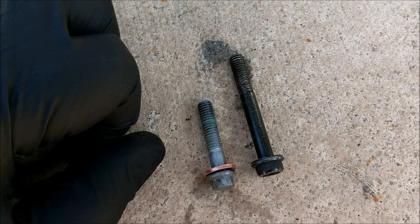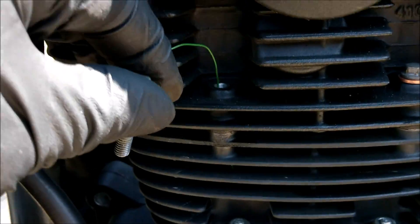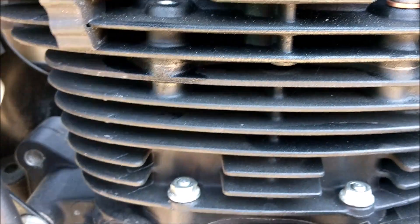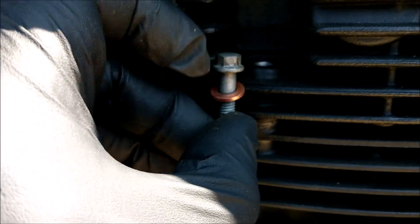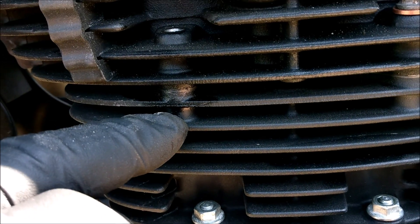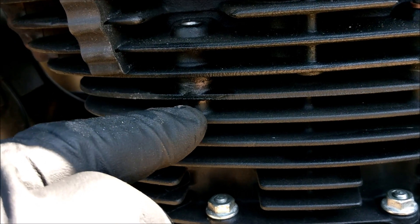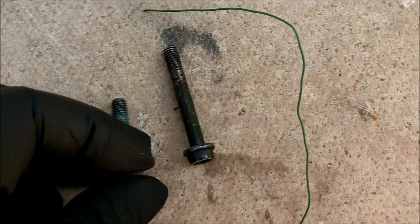When I ended it, the bolt was loose — literally four or five mil up. That's all it's biting into here — four or five mil into alloy — and that's not sufficient to have any clamping power. So let's do some adjusting of that bolt.